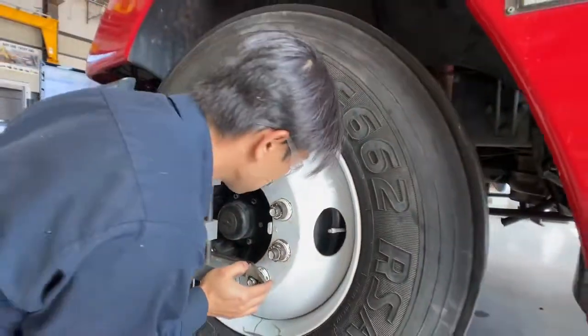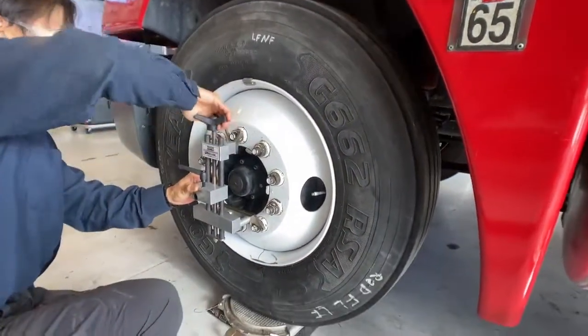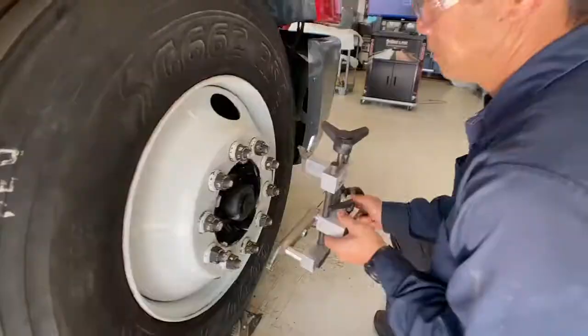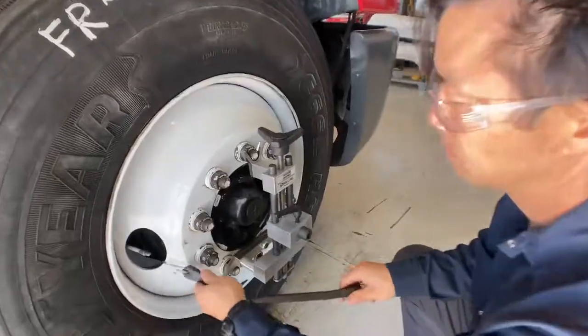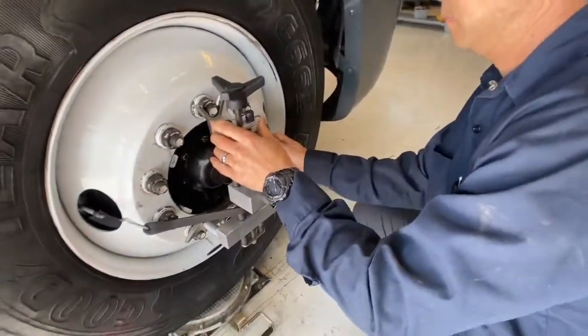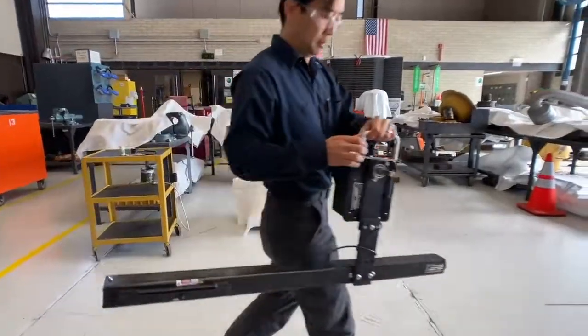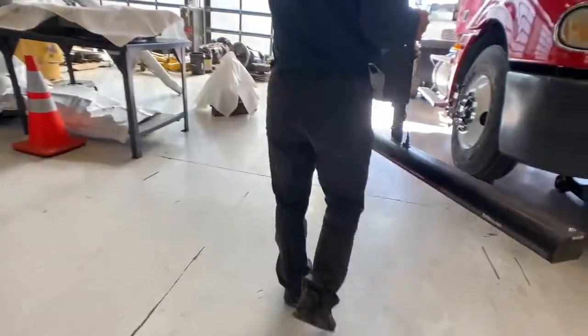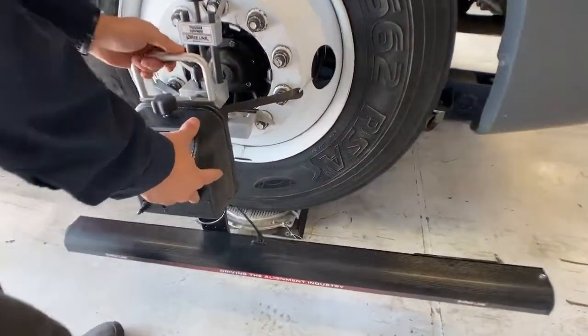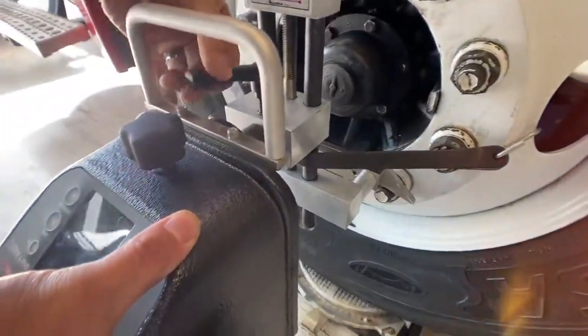Next I will mount the beam mounts onto the wheel rim. Be sure to secure the mounts with rubber tie-down cords to prevent them from slipping off. Next we'll install the laser aligner beams. These must be installed and locked onto the flat side of the rotating pin, which is used to determine rotational position.